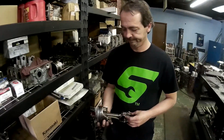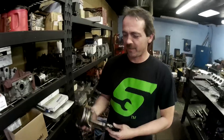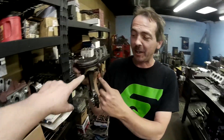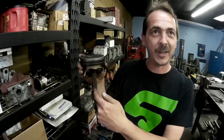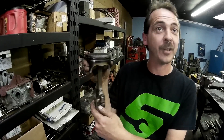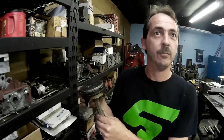Mark's going to describe what it looks like when one has a catastrophic failure. Well, this one actually got dropped and the skirt broke off of it, but basically this is what happened to yours — the skirt breaks out just like that. You just keep driving it. You might hear it knocking, but if you actually quit driving it, you could just buy a new piston, put it in, and keep rocking. But because they drove it so far, it just fell apart — the rest of it just disintegrated. Then you were screwed.